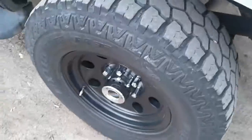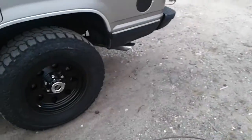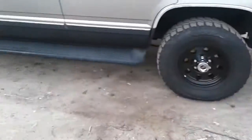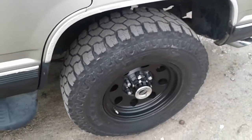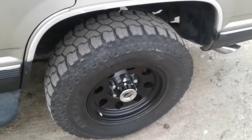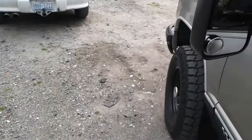These tires are getting bald though. I won't get any traction in snow or mud if the tires are that low. So I'm thinking of getting steel wheels like 15x8s with negative offset, and put like a 10.5/15 tire. Use the same lugs — it has some center caps on it. Yeah, so we'll see you around.